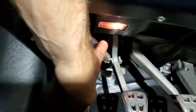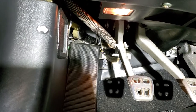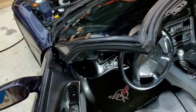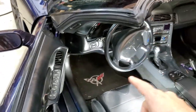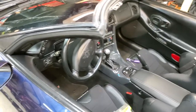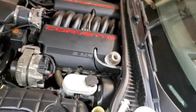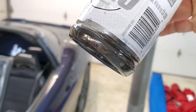The reason I've been able to get away with not doing mine for so long — this is a not-ideal but working solution — is the Lingenfelter spring. That has 100% solved my issue as far as uneven clutch feel. Before I put that in, you'd push the clutch down and it would half-stick, pop out sometimes — it wasn't smooth or consistent. That spring does make it heavier, but I've had no uneven clutch feel or sticking since. I'm going to change this fluid — they call this the Ranger method — until I run out of this DOT 4. It's pretty gnarly stuff right there.